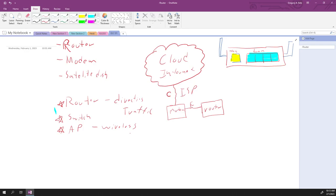Your cell phone probably has more processing power than those home routers do — and for home use that's perfectly fine. You might have under 20 devices. But in a company environment, like a classroom with 30 students all having cell phones plus a laptop cart, you're suddenly at 80 devices. Scale up to a company with 2,000 devices and that little home router switch just won't cut it. So we move up to dedicated devices.